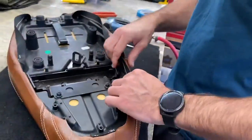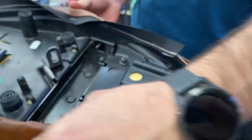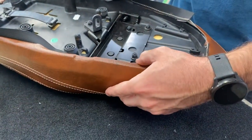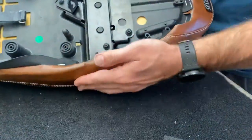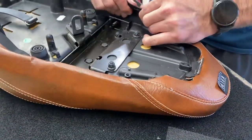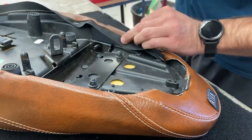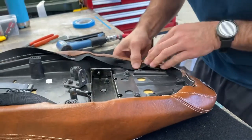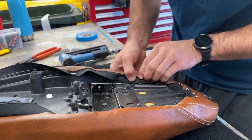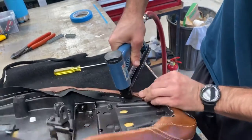You're sort of trying to get a fairly even amount of vinyl hanging over the side - try and get an even distribution of the vinyl so that it forms a line. Basically just pull it and when it runs out of stretch, that's where you need to go. You don't want it to be too tight but you don't want it to be too loose. In terms of neatness underneath - if it's your bike it's completely up to you. The amount of times people actually look at it is not that often.